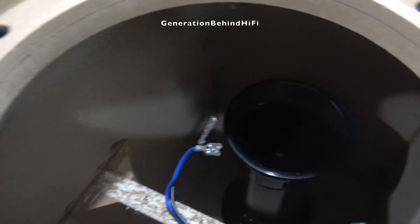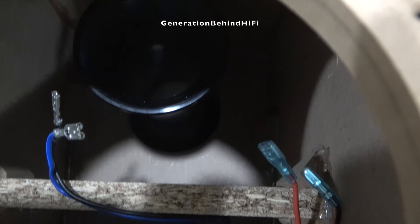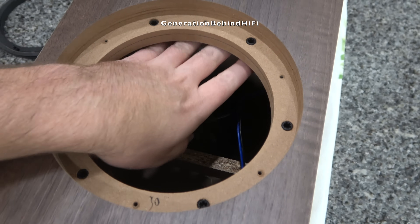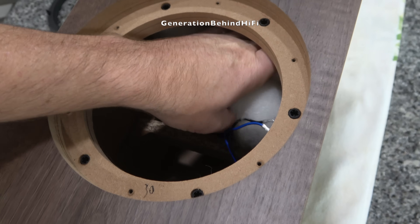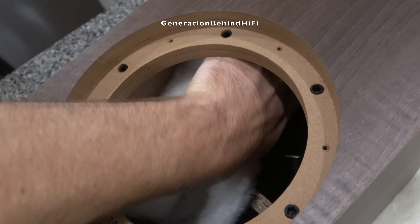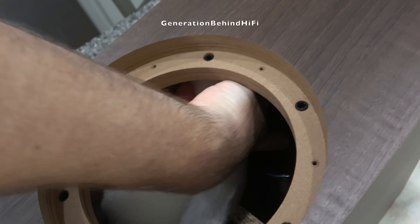The first thing I want to tackle is the cabinet. As you can see from these clips from my Look Inside video, the cabinet is pretty bare and has very little damping material. KEF did include two bunched up rolls of damping material that are strategically placed within the cabinet, but that's pretty much it. Because of the lack of damping material, I'm sure some cabinet resonances are taking place, so let's find out.